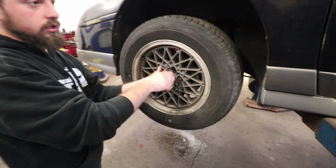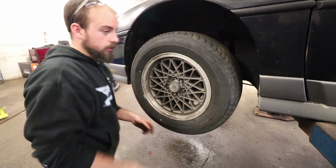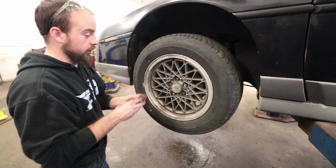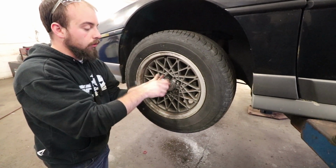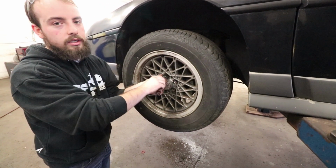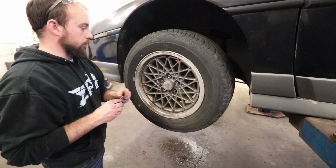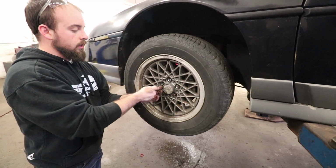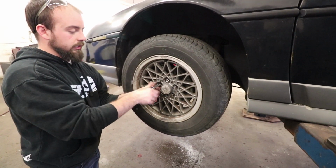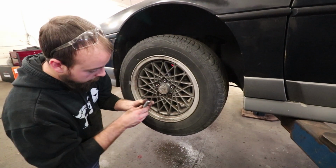It doesn't matter because the fronts aren't going to come back off. We've already lowered the front end of the vehicle. I shouldn't say lowered it, because we just chopped the springs on the front end. I can always get lowering springs later on if need be, but chopping them was okay for now. I took basically 2 coils out of it, so we're sitting on the bump stops. I need to trim the bump stops down some more, but I figured sitting on the bump stops would give me a little bit of room for some suspension rather than nothing.